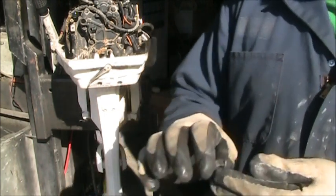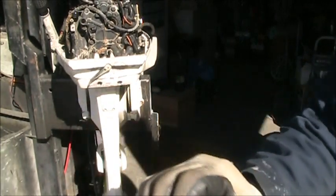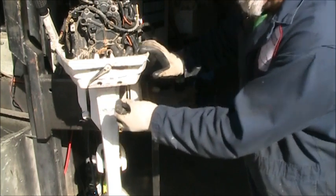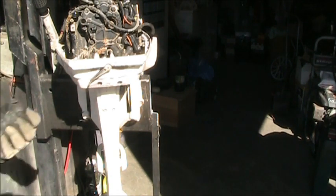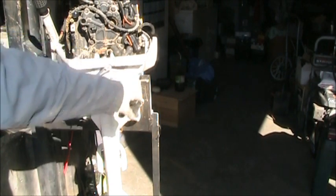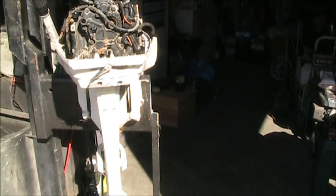Then when I get everything reassembled, I take these little plastic plugs that look like this. You can get them at your hanky spanky hardware store. I put just a little bit of contact cement in, and then I pop them in the hole. And they look almost factory. In fact, most outboards you find will have some of these in it today. These little push tabs. So buy those at the hardware, drill your two holes, line it up just by eyesight with your bolt. And if you're a little off, you can use a swivel, stick it up through there, put your socket on there, and barrel them. Get them out. You got to get them out.